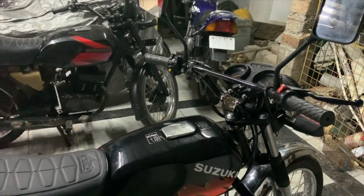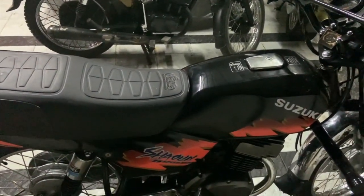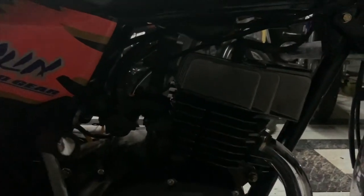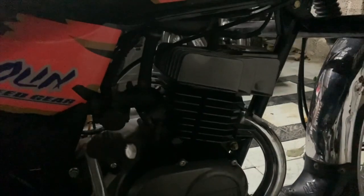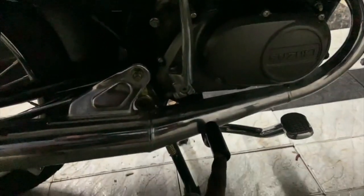There is a small bit of piston ring noise, primarily because this bike was revving a bit high with the old carburetor configuration, which looks like it may have scored the inside of the cylinder. That's not a serious problem — it can go away if run in properly — and this bike hasn't been used much since the last rebuild. Also, a couple of cooling fins broke away when the engine fell during rebuilding, so I'll take those pieces and get them spot-welded since proper welding would require removing the cylinder.